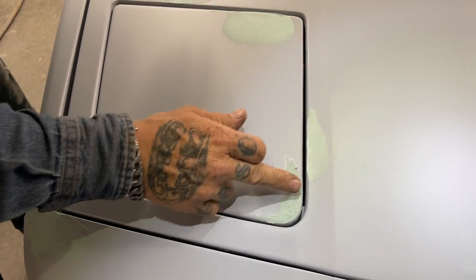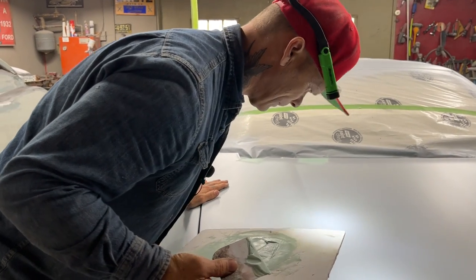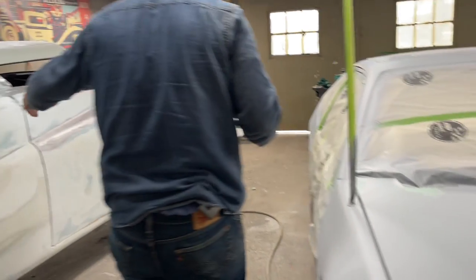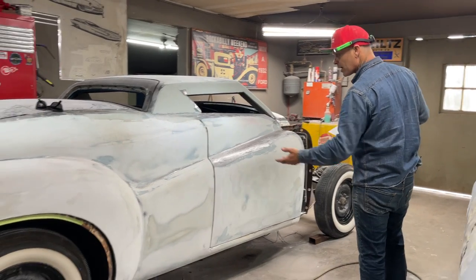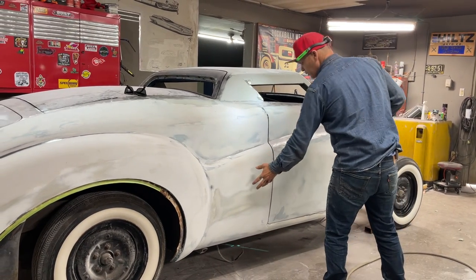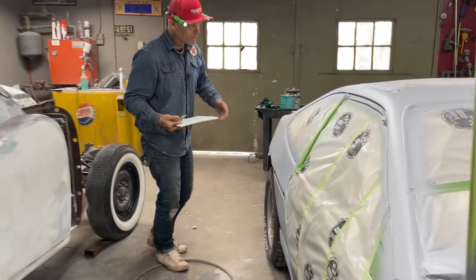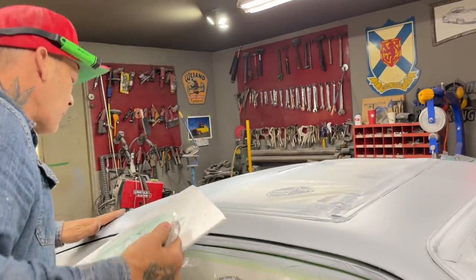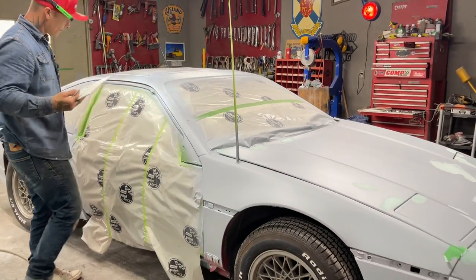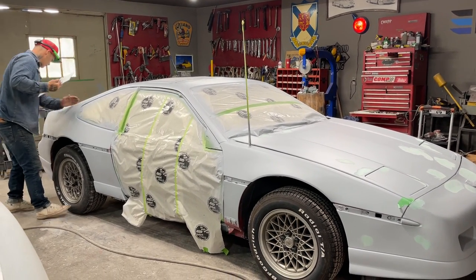And for me, this is how I feel. If you're doing a car like that, and you're trying to get it perfect the first time, and then prime it, going down to 220, whatever, and then priming it and trying to make it perfect, so remember, you're not only doing the filler blocking all out, then you're doing all in putty and then blocking it all out. It just seems to be too much to do at once for me. I like to prime it and then see where I'm at. So that's why I always say 40-80 and then prime it. Give yourself a chance to step back and see what it looks like.